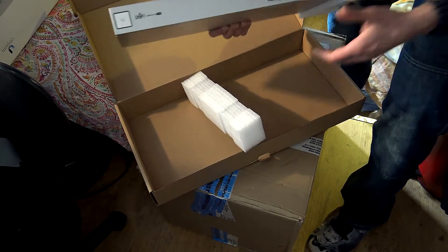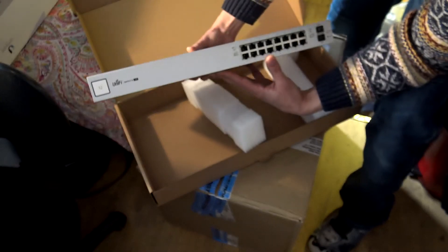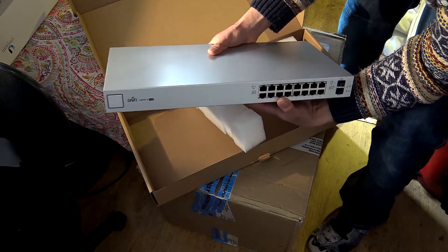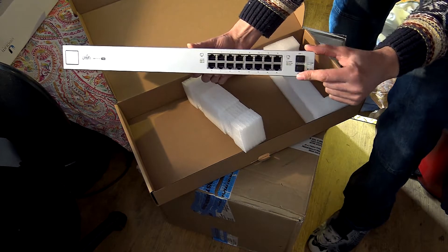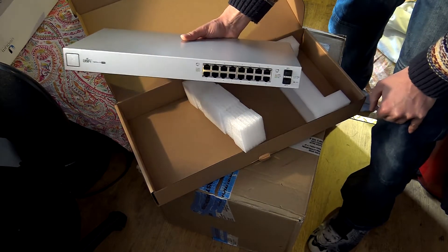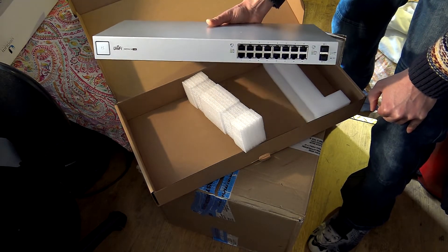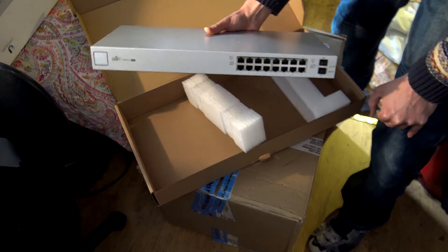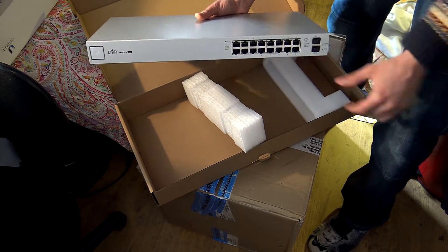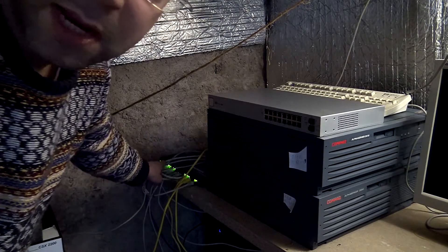And the little guy — the mini mini switch. I was hesitating with a 10-gigabit switch, but the 10-gigabit one had too many SFP ports. Sure, it's good to have 10 gigabit and SFP, but the cables are very expensive. I don't have an unlimited budget, so I'd rather use copper and aggregate the ports — I'm going to try that later.